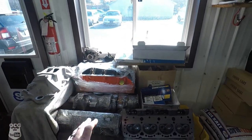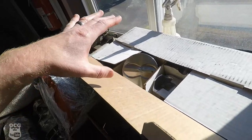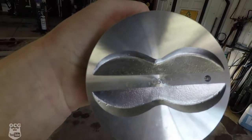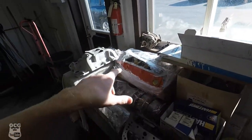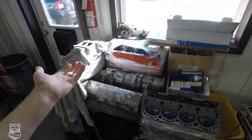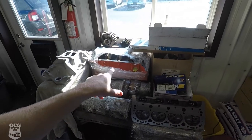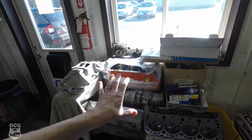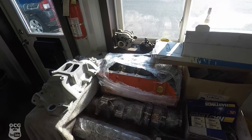They planed the heads and also blocked the deck, which is going to increase our compression slightly. The pistons we got are also going to help with that. This engine is going to be higher compression than stock. We ended up having to go 60-over because the block had a ridge — they thought they could get away with 40 but couldn't. Nobody goes 50, so 60 thou is what we did. I spoke with Terry Eford from Eford Garage, a big GM guy, and he says you shouldn't have any problem — a lot of racing guys go 60 because when they find these blocks they're already at 30 or 40 over.